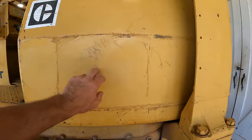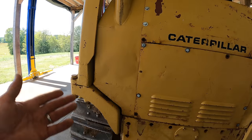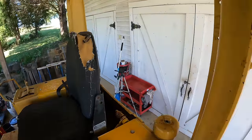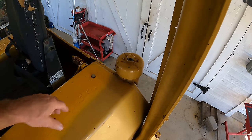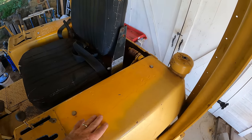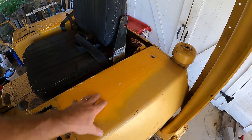First step is this fuel tank. It's behind here, welded into the frame of the machine — it's not something you can remove. If I could pop it off I could do the old trick: put rocks in it, tie it to my tractor tire, roll it around and clean it out. But that's not an option. There's only one access point and there's at least one baffle in the middle that cuts the tank in two or three sections, so you can't reach in and vacuum it out. I don't think lining it is necessary — mild steel tanks on equipment like this run for years and years.